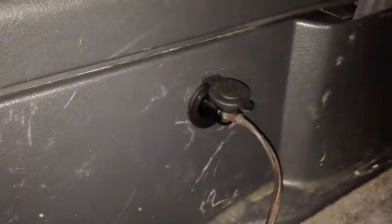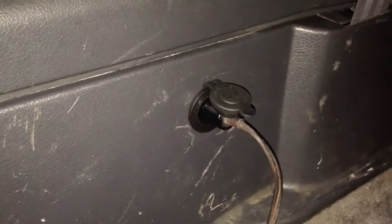But I've never been one to leave well enough alone, and I had a fused 14 gauge line. So I went and got myself a cheap 12 volt socket so that I can just hook up 12 volt devices in the back of my truck. You know, for those times I want to stare into the darkness while I'm draining my battery in the rain. This is probably not a typical use case, but hey, I can do it now.